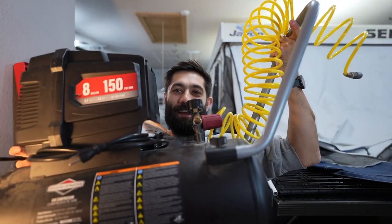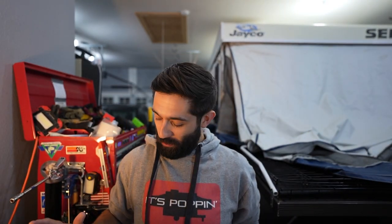That way, just in case you don't have one of these big air compressors, you don't have to worry — you can still do it. Of course, with an air compressor you can use the blowout method, blow the majority of the water out of the lines, and that way you don't have to use as much antifreeze. But these are kind of expensive and you might not have one laying around. So if you don't, this video is definitely for you. However, I encourage you also to check out our other video where we did utilize an air compressor.